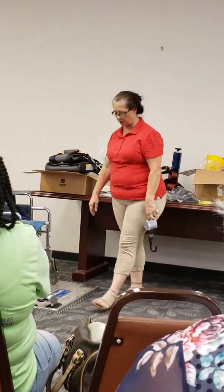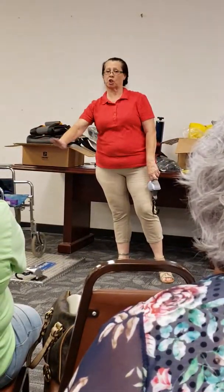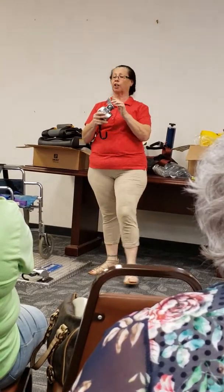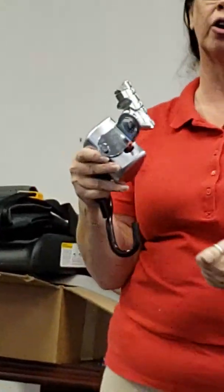Air compressor. Okay, so, anyway, walking through your bus every day, just tap it with your foot. Again, I won't mention counties' names, but I was at a county and I said, let's walk out to one of your special needs buses and just check it out. I said, now do you leave those in the floor all the time? He was like, yeah, we always leave them in the floor, it makes it easier, it's the same one. And I walked right up and did this, and it came right out. It wasn't locked, because there was a little bit of dirt in the track, a little bit of buildup, which did not allow it to completely lock down.